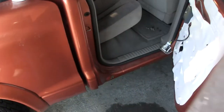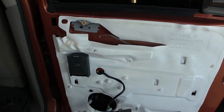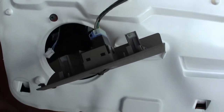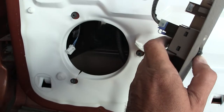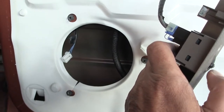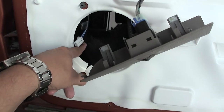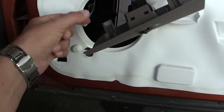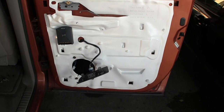Now let me show you the rest of what we're doing here. Here is the rear door, and we have the crossover network installed. As we did not realize before, we cannot use the really deep woofers in here because the window comes down right here. The window only gives you about two inches of depth from the edge of the metal to the window itself. So the original speaker that was in there with the extended ring, which is half an inch, doesn't give you much depth to install a high end or deeper, bigger woofer, bigger magnet speaker.